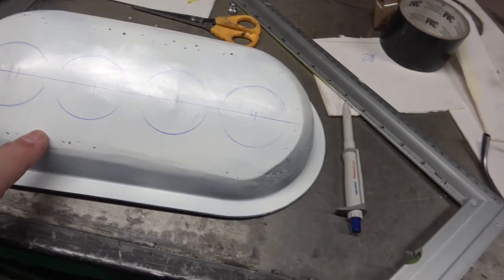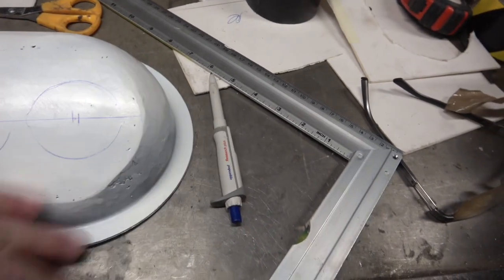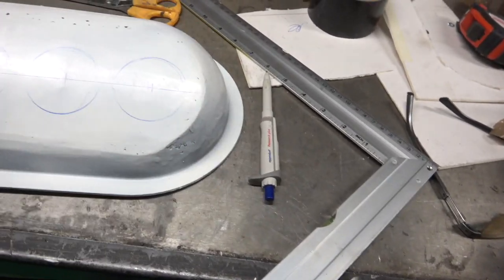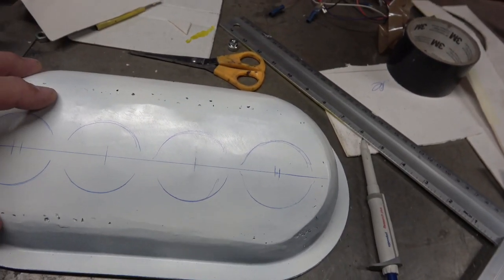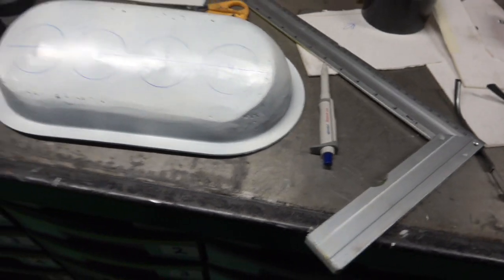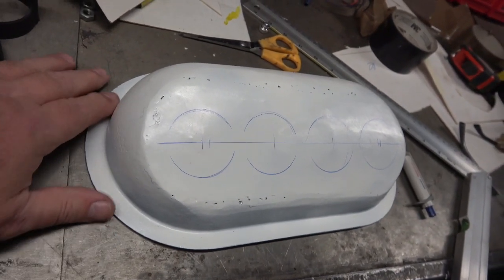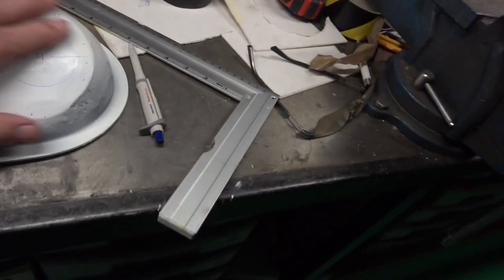You can see there's a few bits here, well, hopefully you can see them, where it really needs re-welding, but it's a lot of faffing around. So because it's internal, what I'd probably do is just put some filler on it, there's a few bits that need tidying up around the edges, so that's what I'll probably do. This will be painted the same baby blue as the car. So when we do the car, we'll do all the other bits with it as well. So that's the next job that has to be done. It's quite porous. Well, porous is probably the wrong word, but it's got quite a lot of micro rust on it, and of course with sandblasting it, it's showing that up. That's why I'd probably put some very light skim filler on it just to make it look a bit tidier.